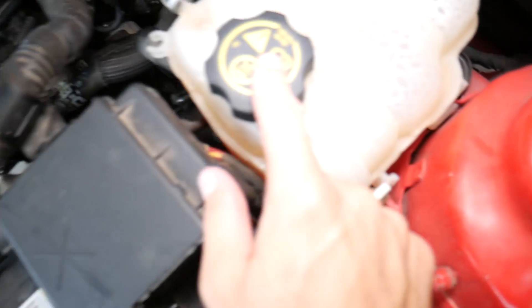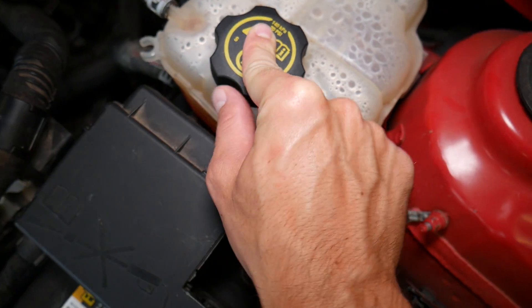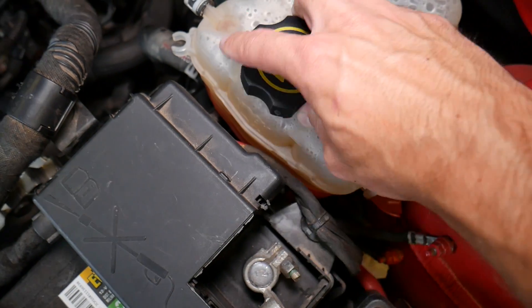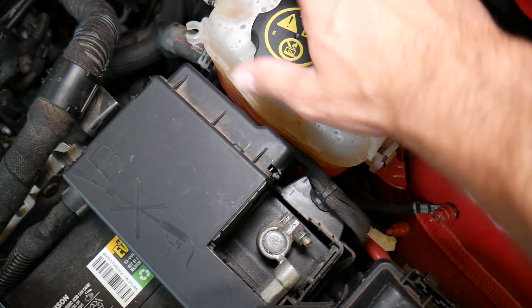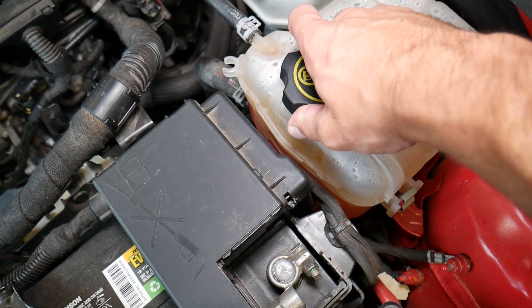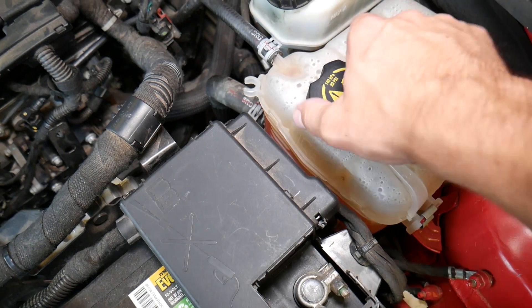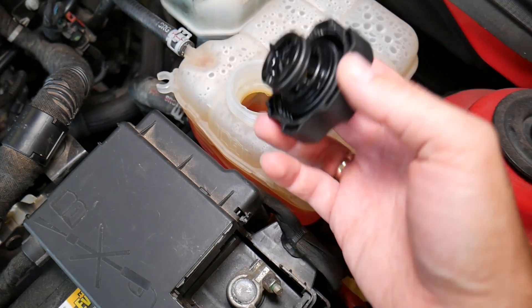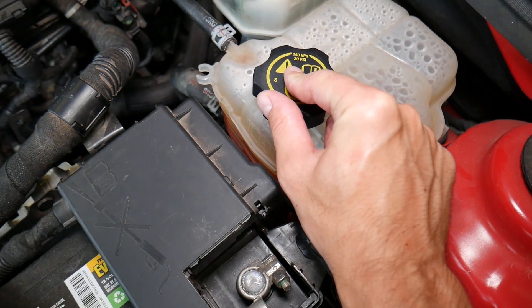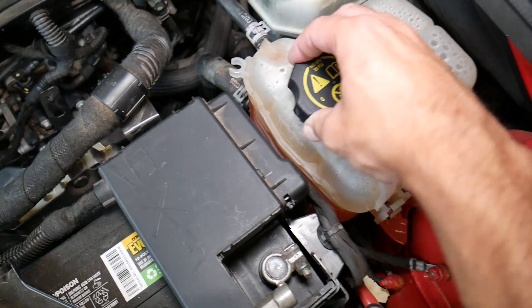As you can see on the cap right here, it says 20 PSI or 140 kPa. So that is a regulated cap — it should open at 20 PSI. Never open your cooling system cap when it's hot. Only open it the next morning after not driving the car for at least 12 hours to make sure it's cool, because that thing can burn you so bad that people will not be able to recognize you. That cap has a valve that is supposed to open at 20 PSI.